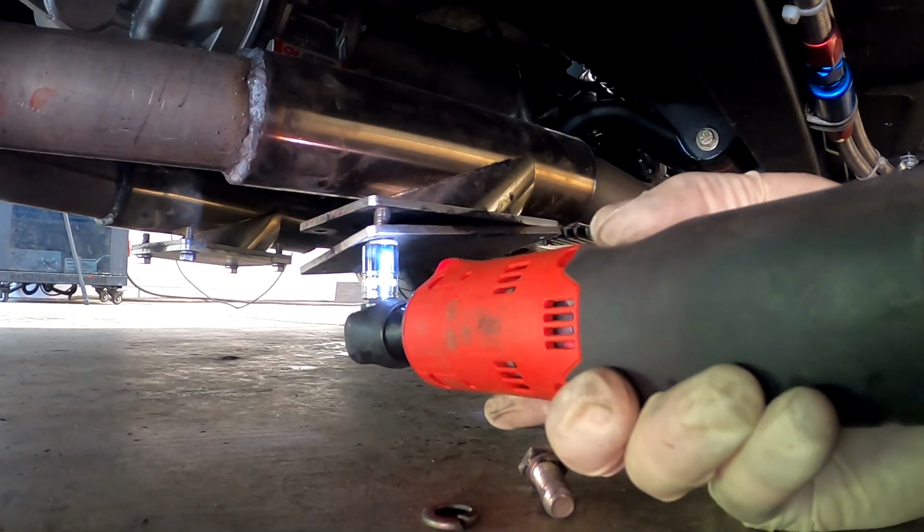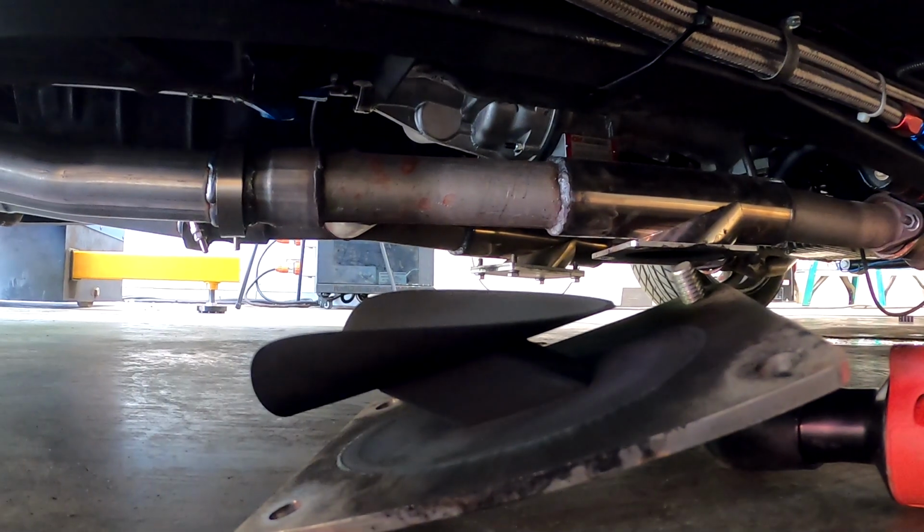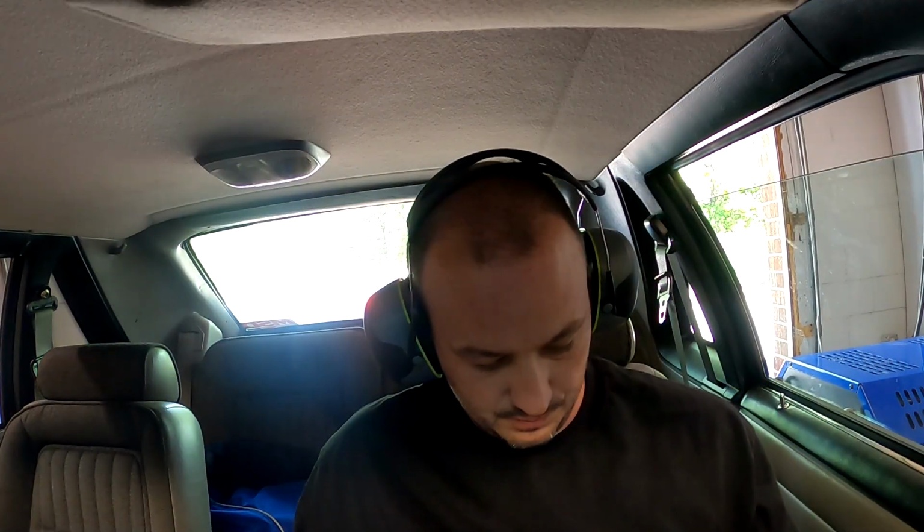Let's pop the exhaust cutouts off. So if the exhaust is a restriction, we're gonna see some changes in fueling and need to make some adjustments. If the exhaust isn't a restriction, then everything should be relatively similar. So we're just gonna try it as is, see where we're at, and again, make some judgment calls based off if it picks up any power or not. Closed loop at idle went to shit, so if we keep it this way, we're gonna have to turn closed loop off.